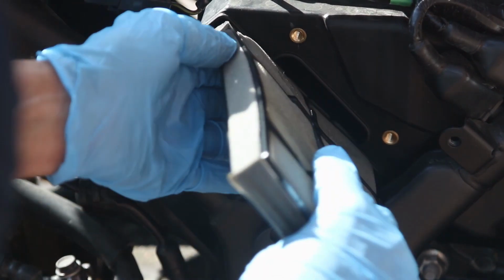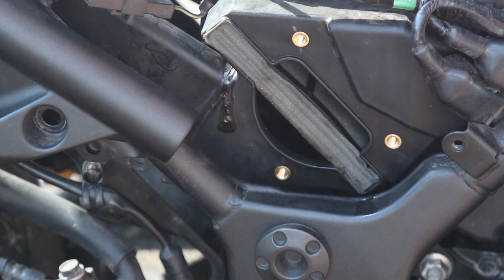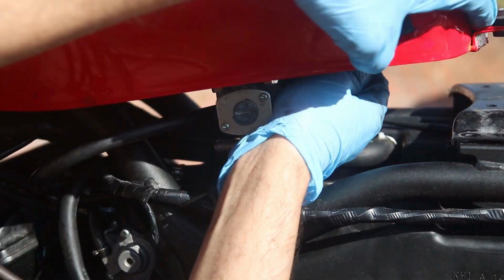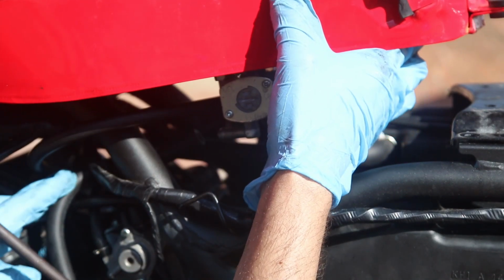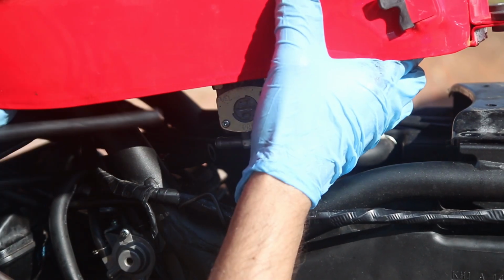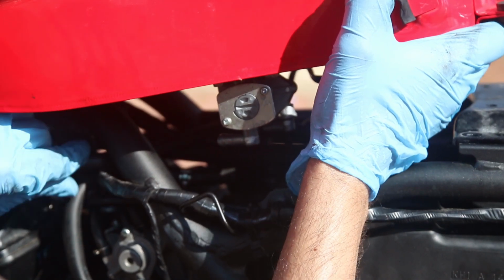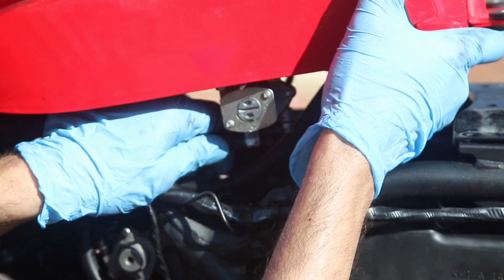We're going to slide the air filter element in there, but we're not going to really bolt it because we just don't want to go through all of that trouble just yet. The thick one that comes off from the top of the carburetor goes into the electronic, I think it's like a vacuum of the plastic thing back here. Once you get that, you have your gas hose, which is this big one. I'm going to route it a little bit differently. The fuel line is the thickest one, and that goes into this bottom one.